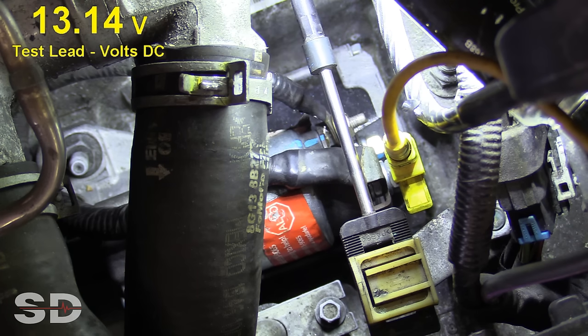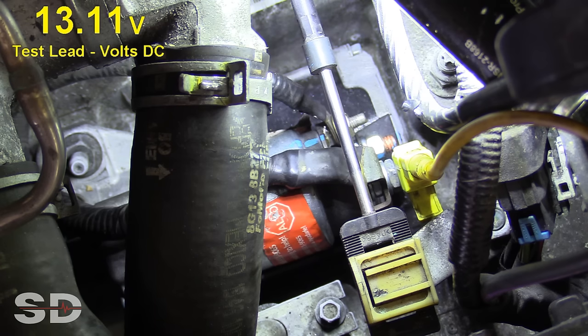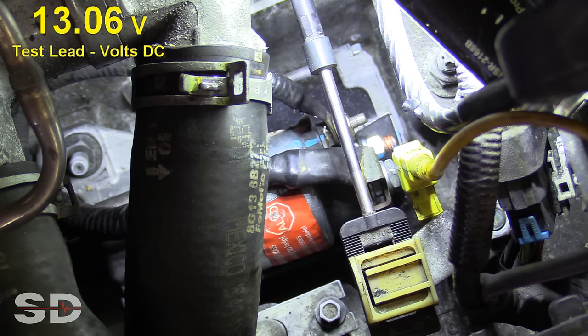Pete, you're back — perfect timing. I need you to crank this for me, this is not starting right now. While before we do this test — we're live here, we've got your voice on camera. When the starter was replaced, it continued to crank or cranked automatically as soon as you connected the battery? It cranked and the car started — and you weren't cranking? So the key was off, you connected the battery, and it started cranking on its own. And after that everything was okay, it started up and ran fine. So if you guys didn't hear that: after the starter was replaced, key was off, battery was disconnected — as soon as he connected the battery, the car started cranking on its own.